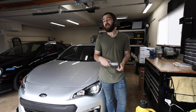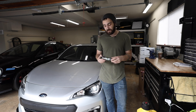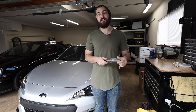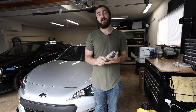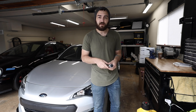Inside the gas tank I have different types of gas — I may have gasoline, I may have a different content of ethanol in there — so when it hits the flex fuel sensor, results are going to be a little skewed. For baseline, I have about E72 in the car right now, about 72% ethanol. I went on Amazon and found one of these E85 test kits, which are extremely easy to use. I want to run this test twice to validate results, and I also want to talk about some pros and cons of testing your own ethanol.